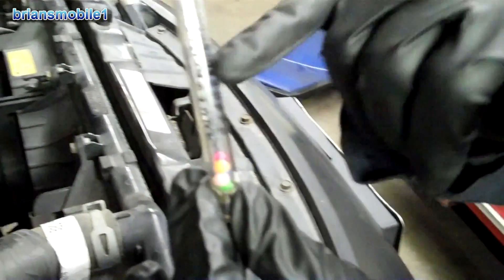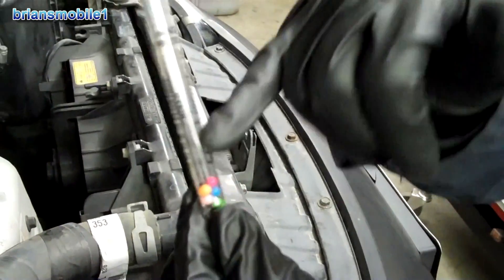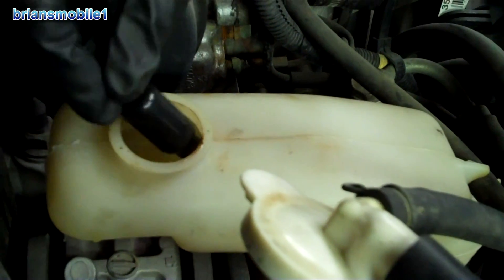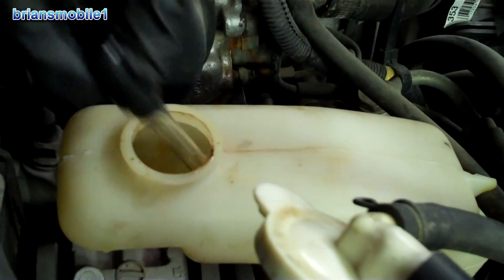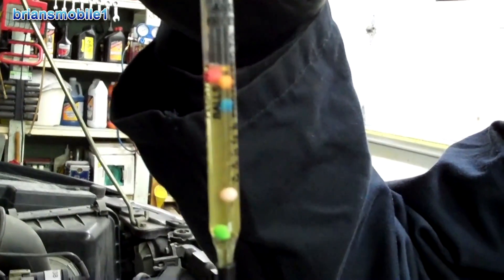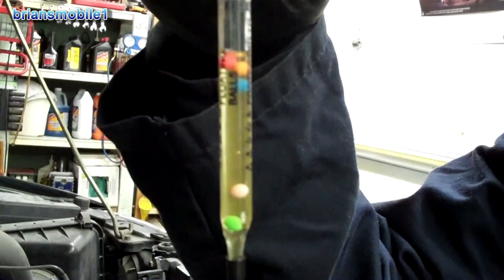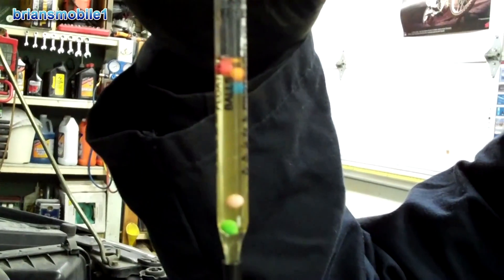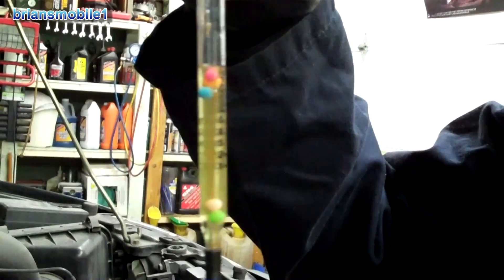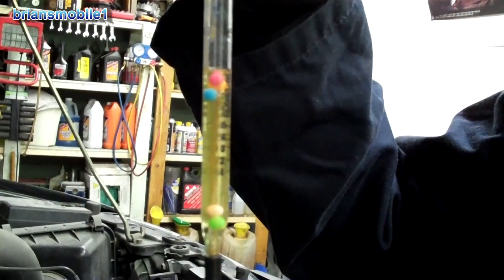So it corresponds: how many balls float is how many degrees of protection it is. We're going to get down here and get some coolant out of the reservoir. And you can see here that just two balls — well, two and a half maybe. That one's kind of slowly moving up and then going down. I'd just say two solid floaters.